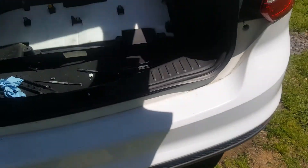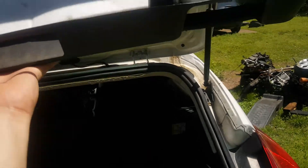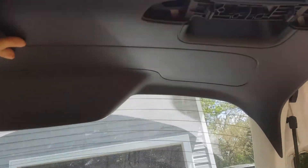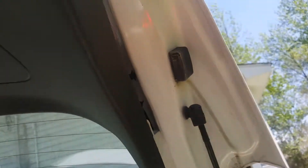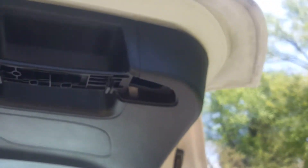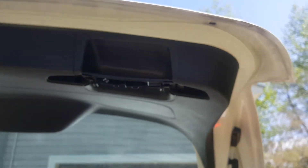We'll go ahead and open this back up. All we need to do is get our cover snapped back on. We're just going to slip it back on and get our little screws back into place. I'm going to put a little bit of white lithium grease before I go to snapping it down. Just push it right back on there — line up these pins, look in there and make sure they're lined up. If the end ones are lined up, the rest should be lined up too. Then just give it a firm push. The middle's fastened and the edges are fastened.